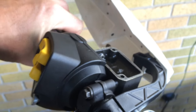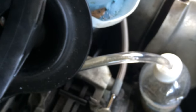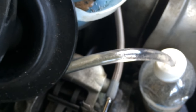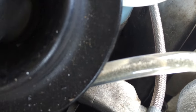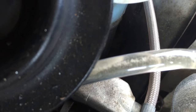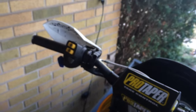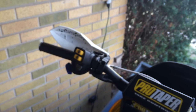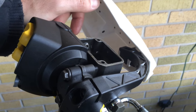Start to pump this down. You want to keep doing this until the fluid starts to come through with no bubbles and it's completely clear. You've got to keep adding brake fluid up here — don't let air get down into the caliper. Just keep doing slow strokes.